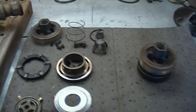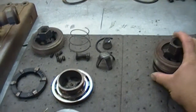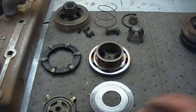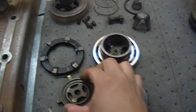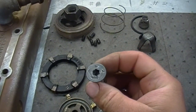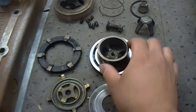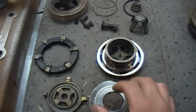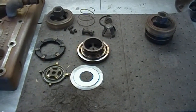Here are the two valve cartridges. This is what they look like when assembled, and I've got one all taken apart here so I can explain it easier. This is the one that failed — or I shouldn't say failed, but the one where the screw loosened up and impacted the piston on number three cylinder. So I've taken it all apart, cleaned it up, and made sure that nothing's damaged in the cartridge itself. Neither component is damaged, but I'll go through how that works right now.